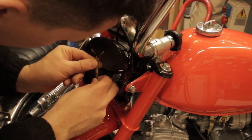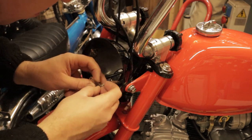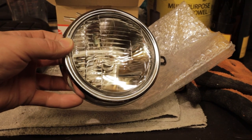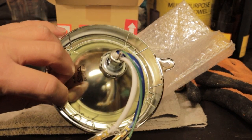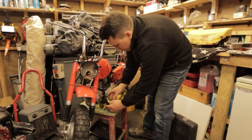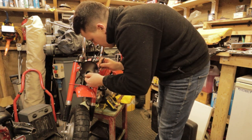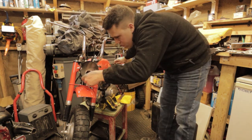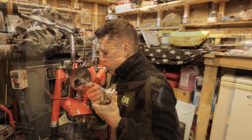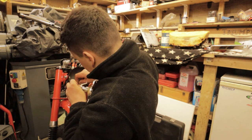For lighting you get a front headlight and a rear tail light, operated via a single switch — a very simple 6-volt system. The harness that accompanies this bike is also very simple. One thing I did was get my multimeter out and just make sure the power wires for the light were in the right place, working, with no broken points. This is an original harness recovered — I wanted to make sure it's actually working before plugging the light in.